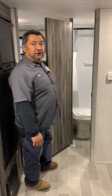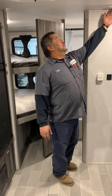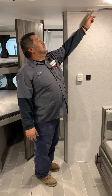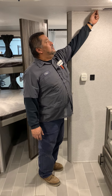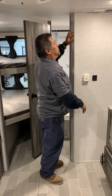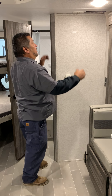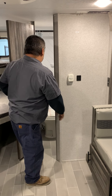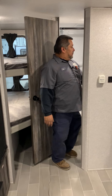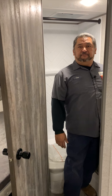The booster for your antenna is going to be here — if the green light's on that means you're boosting your antenna, and then you want to put your coax on here. The wall has a backer in it so you can hook any bracket that you want for your TV, and it's got the plug in here. This would be if you wanted the King antenna or satellite. The GFI is going to be in the bathroom here, so if this thing trips out you just have to reset it for the outlets.